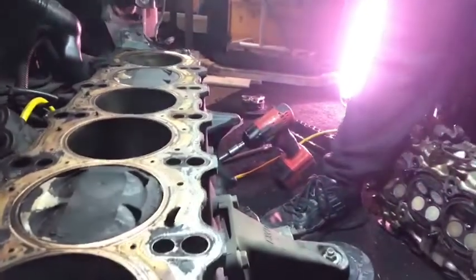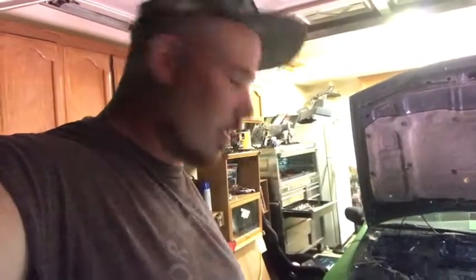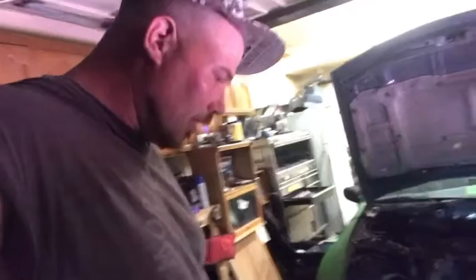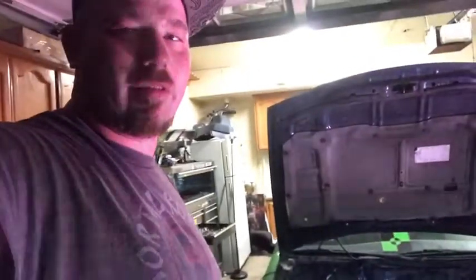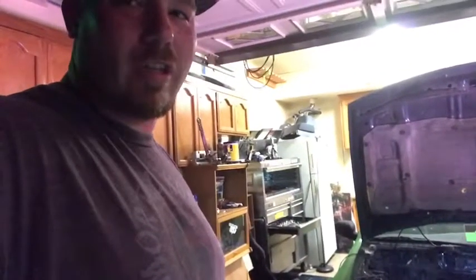Well, that's definitely why we can't turn the engine. See the wearing on the side of the piston there. This block ran until it stopped. Well, it's always bad to get bad news, but she can still run. Just gonna take more work and stuff we ain't got right now. Well, hold on. Are these sleeved? They are. Yeah, they're sleeved. No, the block's fine. We'll be able to make her, but with some work. She ain't gonna be bolting in and going right now though.